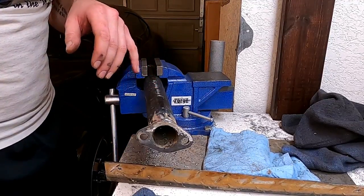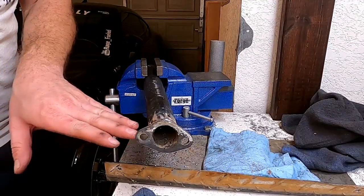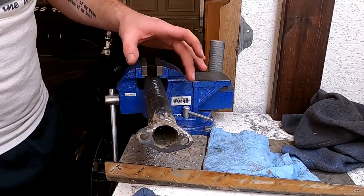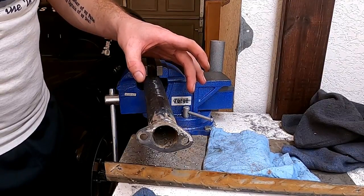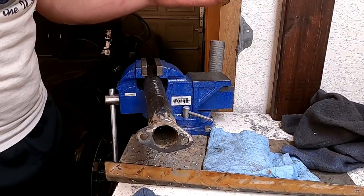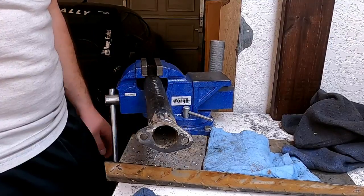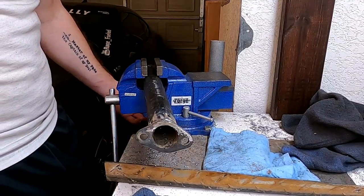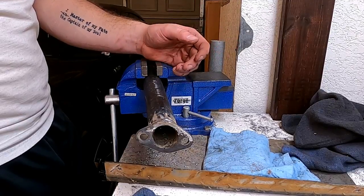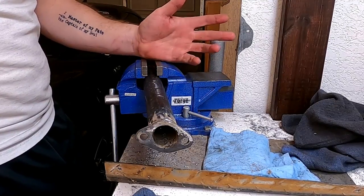Basically what we're going to do: I'm going to do 13 holes, which is going to get it through this side and the back. Then I'm going to do 13 down 90 degrees, which will put two more rows. And then I'm going to do it on each diagonal. So total we're going to have eight rows of 13. So that's 104 holes. I think that'll be good enough to get what we're after with this. It's going to deaden it a little bit and get some sound out, but I'm not looking for a quiet muffler here, obviously. This is a straight through thing, but this should help it a little bit. I might put the next size bit up and punch these holes out just a little bit larger — I've still got some meat left on the pipe.